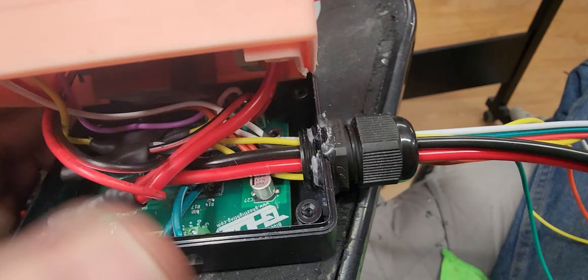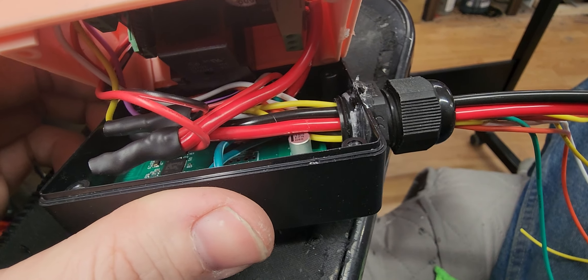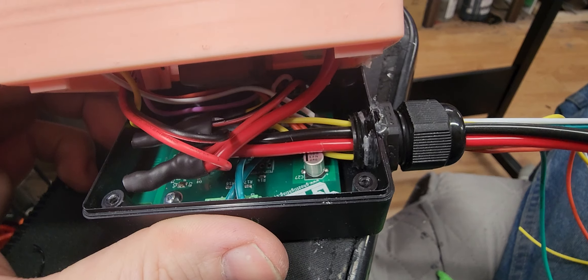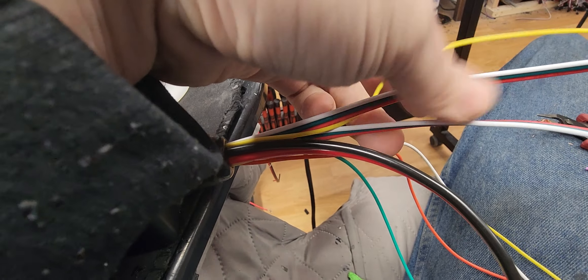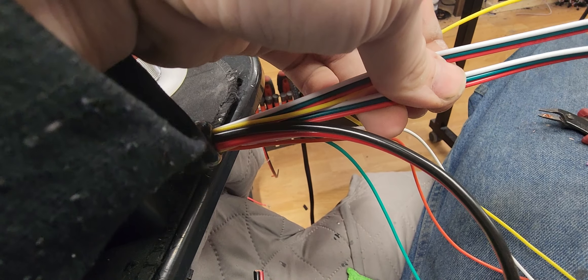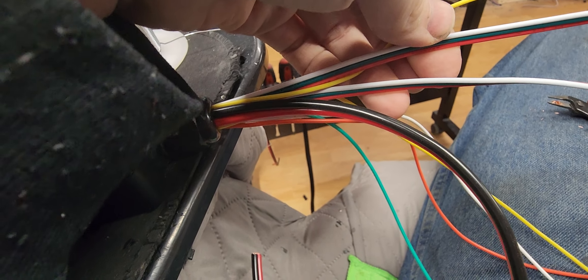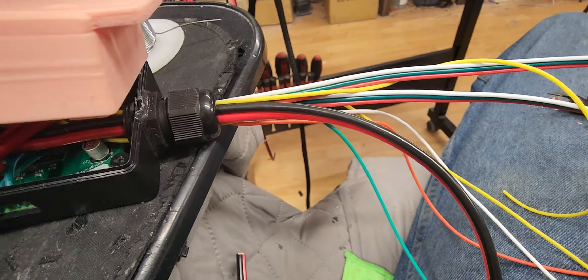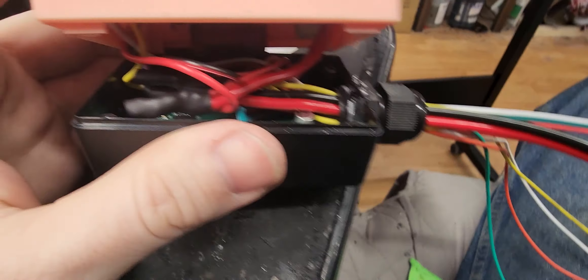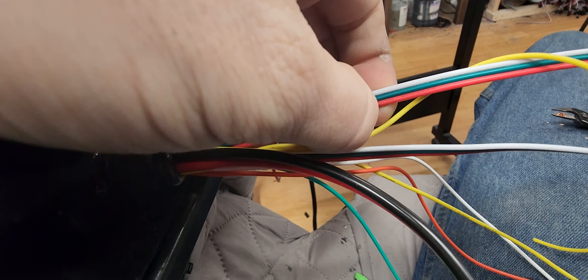If I am using this for a five-volt setup — which this setup will be — I put a five-volt inverter in each light. The 12-volt outputs will run to each headlight and power the inverter as well as anything 12 volt. So I will split it off and connect both the inverter and 12-volt devices to these powers and grounds, keeping everything nice and simple and not too overloaded.